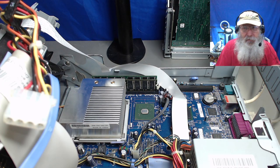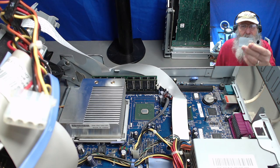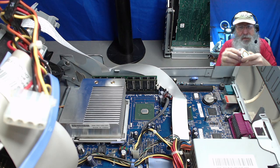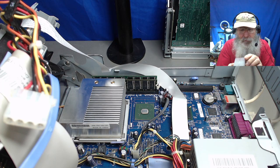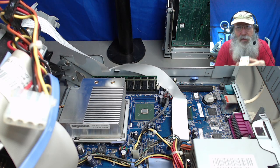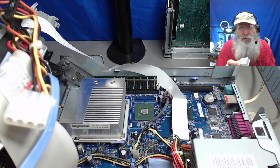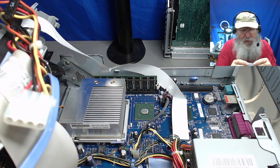I could even look for alternate fan power sources for putting a fan on there. But in reality, this is kind of in the shadow or draft area of the bigger CPU heat sink, and it has those two nice fans up front. I've got to have good thermal contact with the Northbridge chip before I even consider anything like a fan. I've got to get the heat from the heat spreader right over the die of that Northbridge chip into the heat sink that's over the top of it.